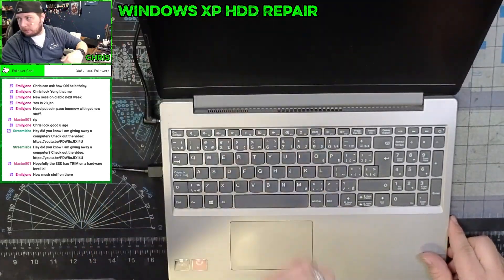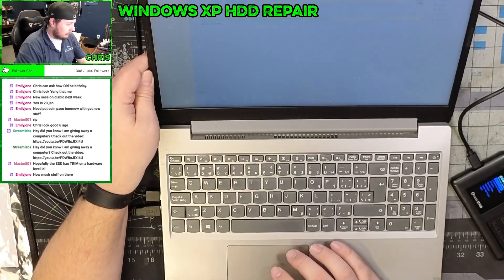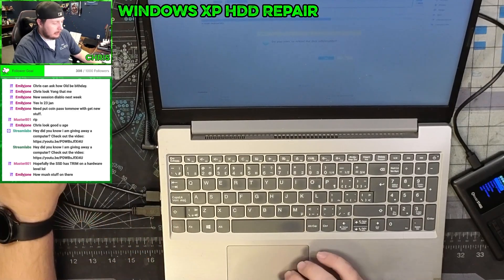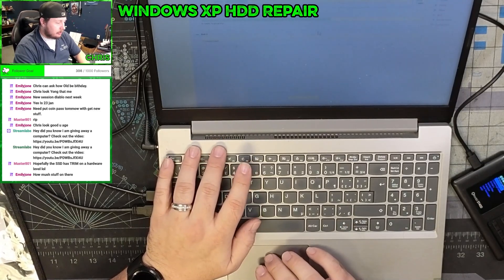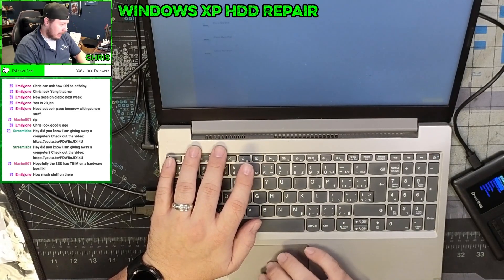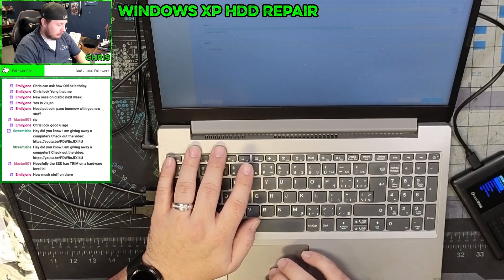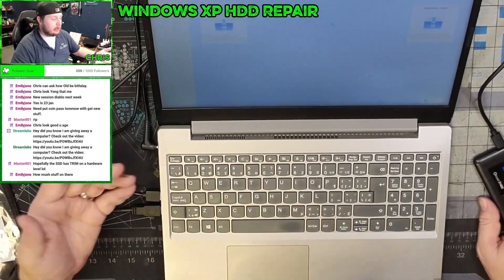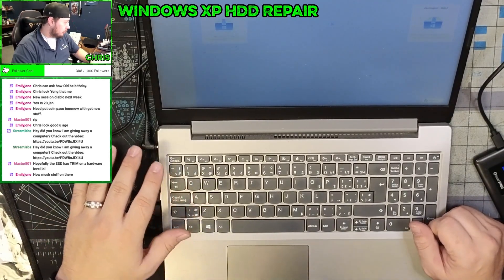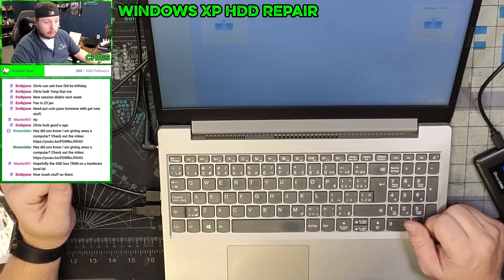So let's go ahead and do a clone on this laptop before I have to hop on this call. This is going to be close, because this hard drive that's in here has a lot of bad sectors, and generally clones don't like it when you have a lot of bad sectors. Hopefully it'll work. If not, I'm going to end up installing Windows 10 onto this SSD, and then after I install it, I'll just pull up this drive and move over whatever I can.